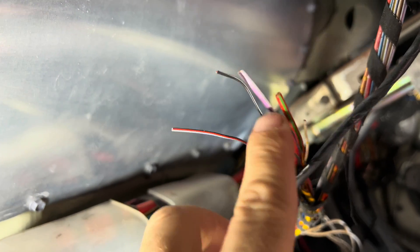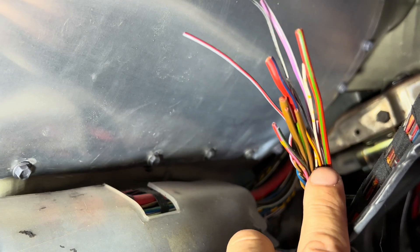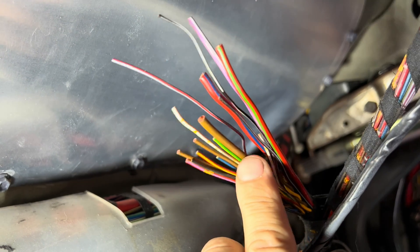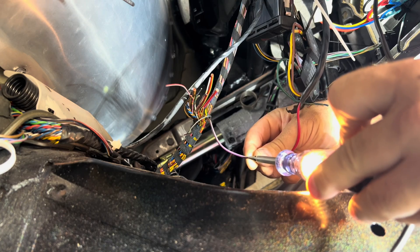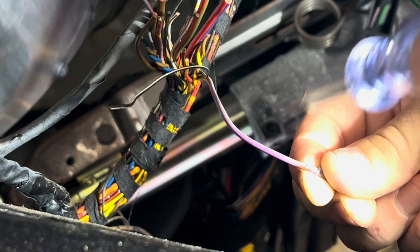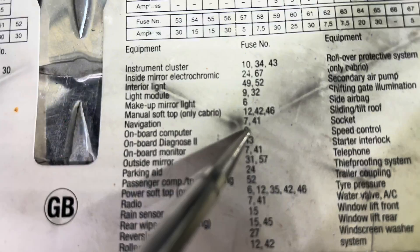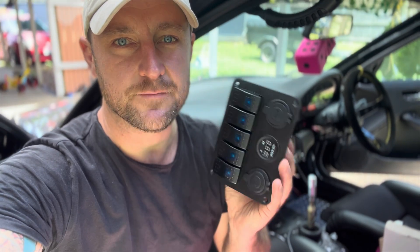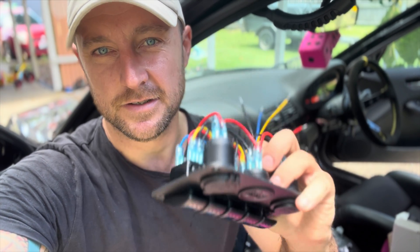This is some of the wiring I've deleted. When I cut it all out I cut it staggered so there's less chance of any of them touching each other — everything's fused anyway but it eliminates any issue. With the ignition on, that purple wire there has power with accessories on. That's the one we'll be using to get our main power, which is fuse number seven — navigation circuit. You can tap into most things as long as the amperage doesn't exceed the circuit. Anything running off this switch panel is going to be on a relay anyway so it won't have high amps running through it. I'm also going to wire this up to a plug so I can easily remove it if I need to.